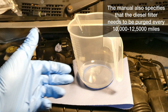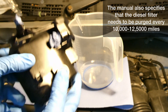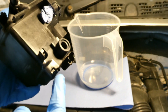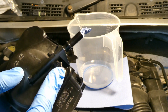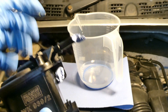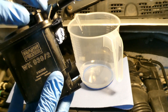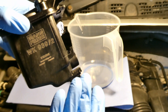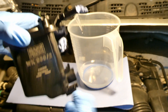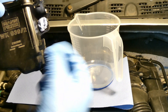If your car's computer tells you there is water in the diesel, what can you do? There is a small outlet coming out here, related to that valve at the top. Because water is at the bottom and diesel is at the top, if you undo that valve, the water at the bottom of the filter will leak out. Then you close it and you've purged the water. On my car there's normally a pipe that comes out of here and goes down to the bottom of the engine so it doesn't leak in the middle.